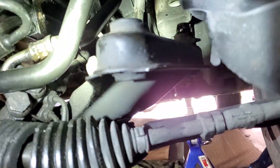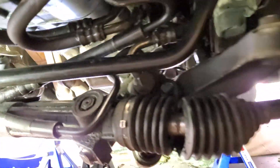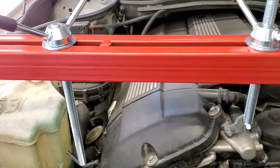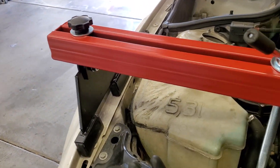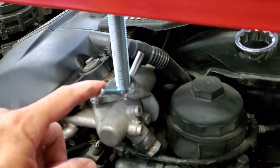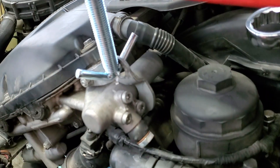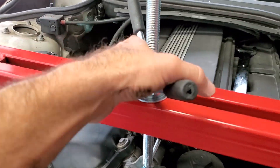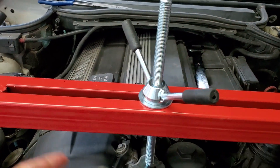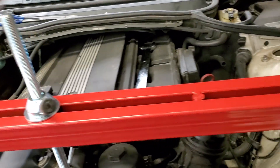I ended up on the steering rack doing the 50's Kid way and not the Hans Garage way — I'll show you why. But first, this is the engine support bar I got from Harbor Freight for about 60 bucks. It works just fine — it's perfect. You don't even need the chains that come with it on this engine. You just hook it into the engine lifting point here and give her a squeeze, and you can actually lift the engine up with this once you've taken the motor mount nuts off of each side — those are 16mm.